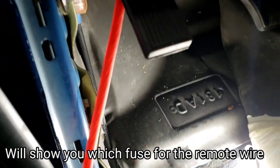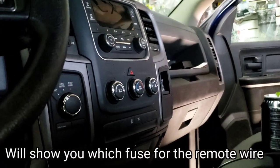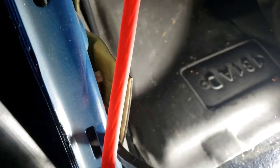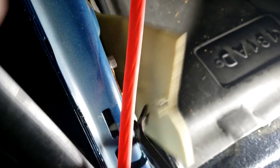I don't want to take the whole radio dash off to get to the speaker wire. So what I'm going to do, I'm coming over here and prying this out. I'm looking for gray/violet and gray/yellow. It should be right there — you can see gray/violet and gray/yellow. I'm going to pull that wire out.